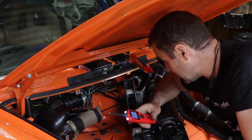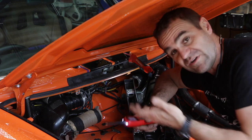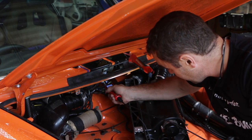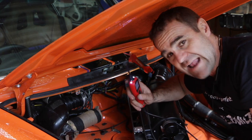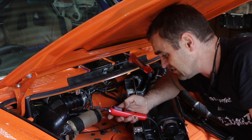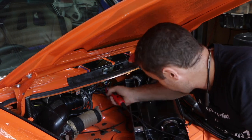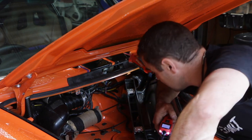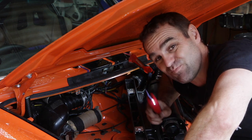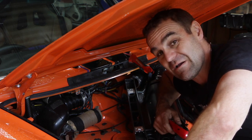What I've found is on the fuse panel, the wire that kept blowing the fuse was this red-white wire. I've traced it to the motor itself, disconnected it, and when I touch the end of my power probe onto where the red-white wire goes in, it tells me it's grounded. If I try to send power to it, it trips straight away — so I can trip this instead of going through a million fuses. I've found that circuit is the actual issue, so we're going to pull the motor out and see if there's anything I can fix or whether it's just toast. It has worked intermittently, so I know it still works.